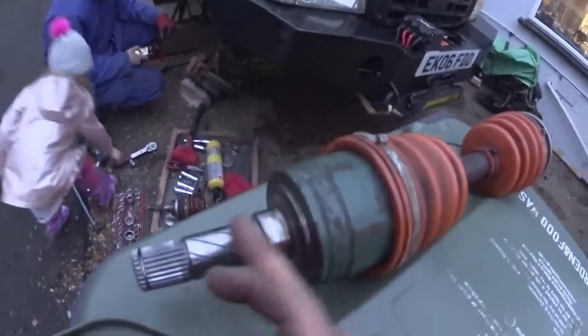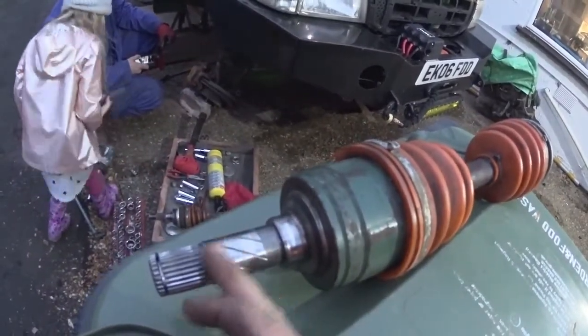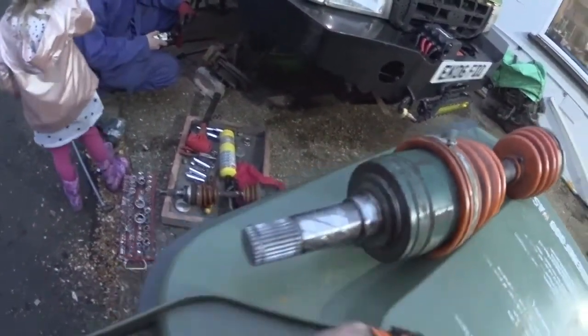If you pull that cover out and it leaks oil, where that shaft end goes, it goes past the seal, past the diff carrier bearing and into the diff. You can see through the other side to see if something dropped out or if the planet gears are in two pieces. I just poked a torch in where that shaft goes and the centre pin's still in the diff and the spider gears aren't sat in the bottom, so maybe it's the RFW.